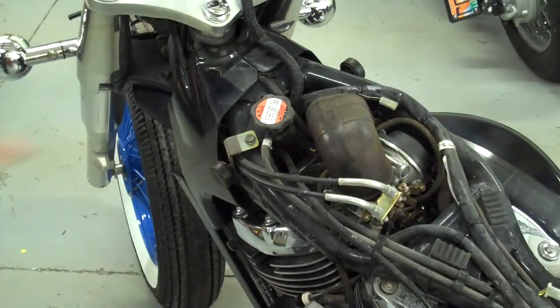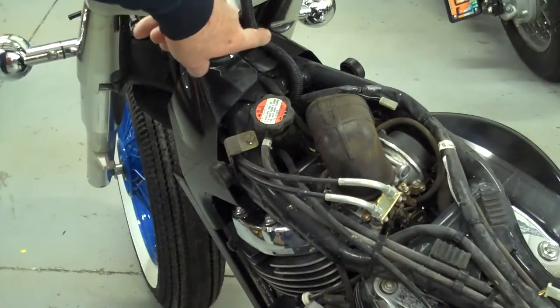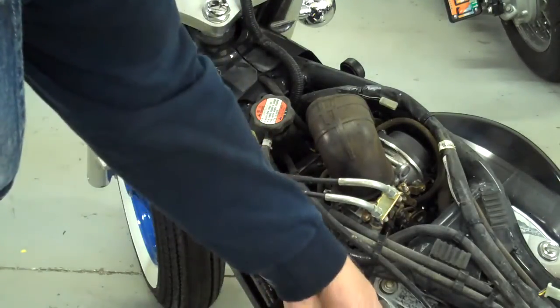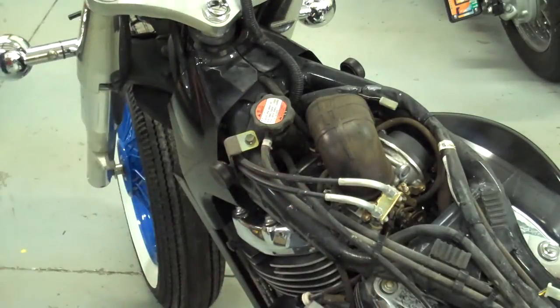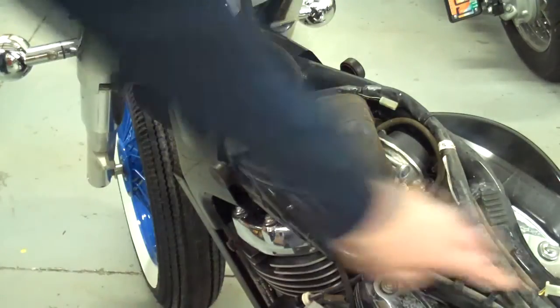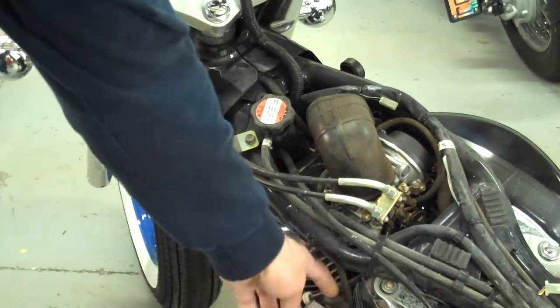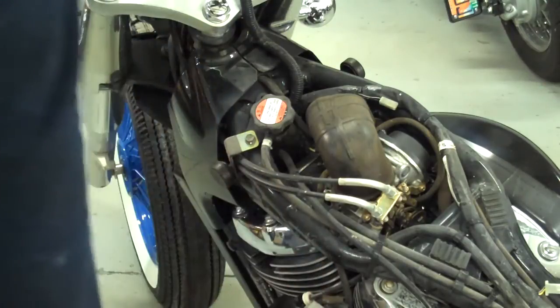Let's mount the tank now. I've taped this wire up front here so that it's ready to hook onto the gauge, and then my fuel line is hanging out here. I want to make sure all this stuff is kind of ready to go so when I slide it on I can see and I know what to do. There's a connector here we're going to have to connect on too, and then don't forget your little vacuum line down here for the carburetor.